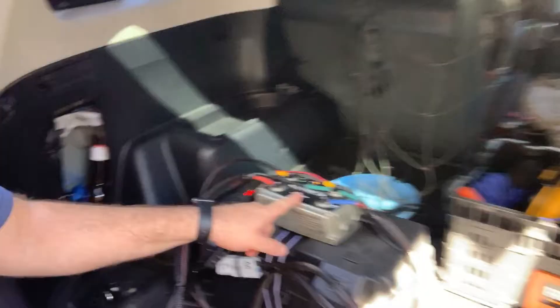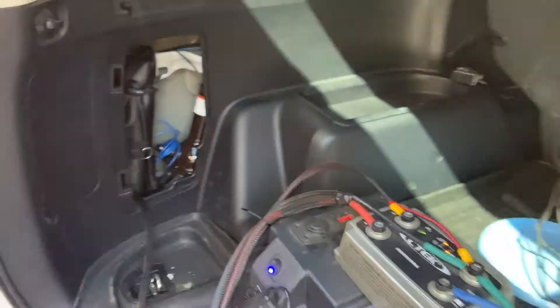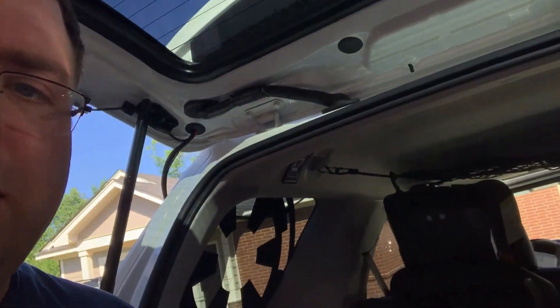The 25 amp — I don't need the 50 amp, because then you've got to run four gauge wires or some massive wires and they can be tricky to wire. What's cool about this is it can see both the solar and the alternator, and it's charging the battery. When you're driving on the road, it'll use a combination of solar and alternator power and keep that battery charged at the proper voltage — be it bulk, absorption, or float. It's a smart multi-stage controller, so it knows the state of charge of the battery and everything.